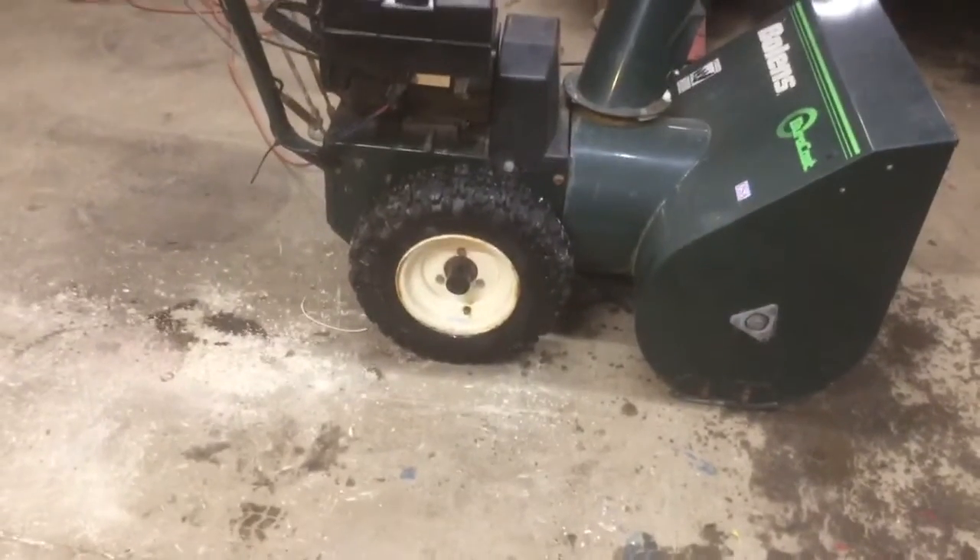I fixed the tire, I believe. I used this stuff — Tire Jet — I bought it off eBay a while ago and used it a couple times. You put it in this little syringe applicator. I still have tire slime, but this Tire Jet works really well. What happened was there was just a little tiny crack on the sidewall — weather checking from sitting — and it would just seep a tiny bit of air. So I put the Tire Jet on it.